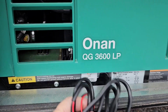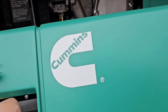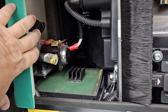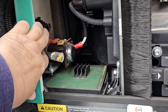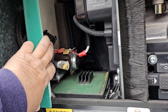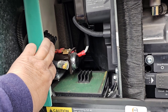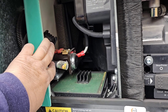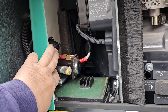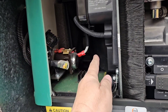The way I'm going to install it is by connecting to the hot side of the generator isolator solenoid. Right here is the generator's isolator solenoid, and this big cable is hooked to a mega fuse in the battery box. This is a 2023 Unity RL, but it's the same for all model years except older ones like 2014 and older. For 2016 and newer, everybody has mega fuse blocks in their battery box, and there's a large cable that runs from a mega fuse in the battery box to this isolator solenoid.